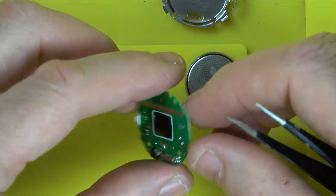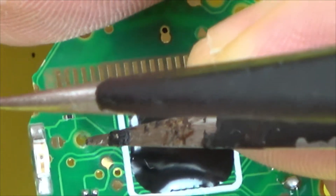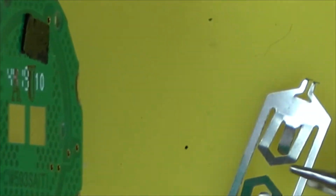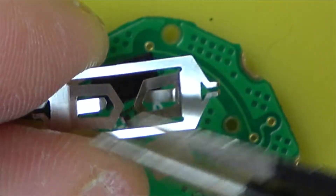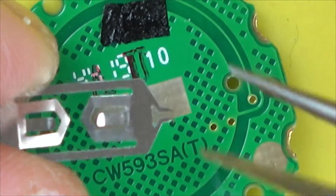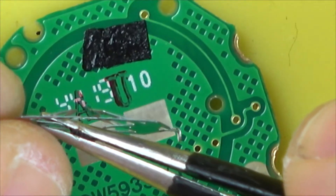Now are these soldered on? I'd say they fold over. So there's no actual physical contact there — it is just purely in the middle. The battery makes contact with these outer prongs here. But look, it's the inner prongs here which have to touch these two pads. I reckon we need to bend down these two inner prongs a little bit so that they're going to make a definite contact with here without putting pressure on the battery. That's what I think.